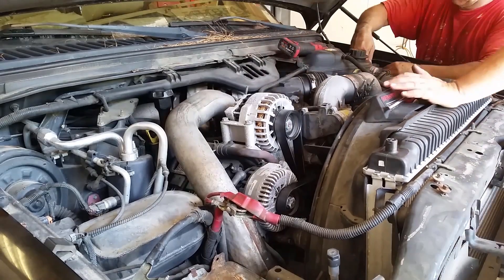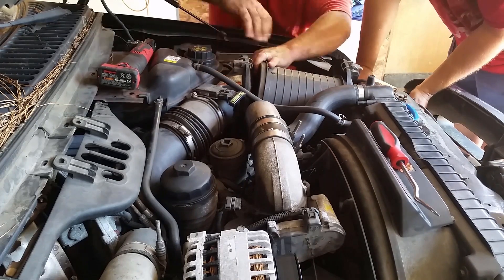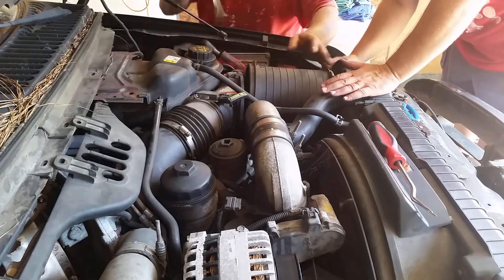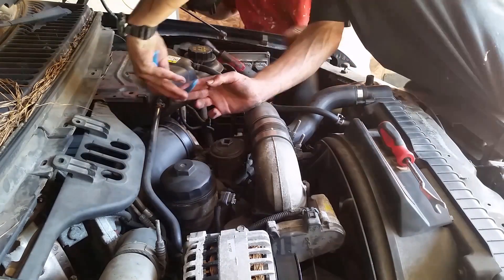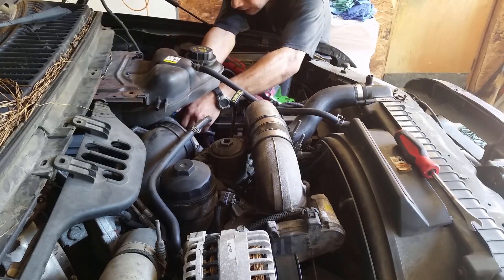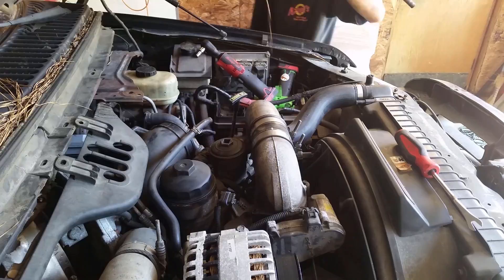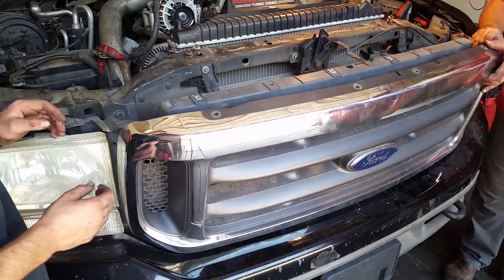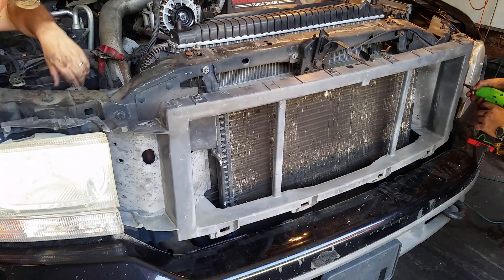Here we are removing the air intake tube — 8mm holding the little clamp on. And here we are removing the air filter. You're going to want to remove all your air intake and all the hoses on top. I try to get as much as I can on video so this is going to be like a guide. Take this little reservoir out — there's a hose on top, a big hose on the bottom, and two bolts on top holding it, then it should just slide right out. To remove your grill, there are four Phillips head screws on top and it slides right out — there are going to be little clips on the bottom.